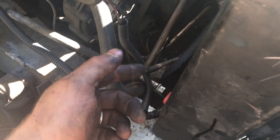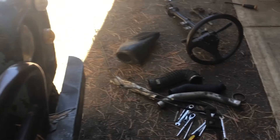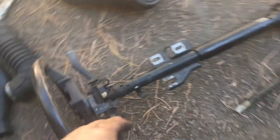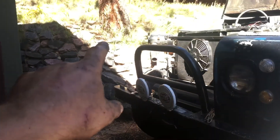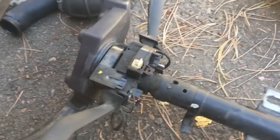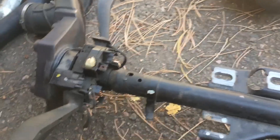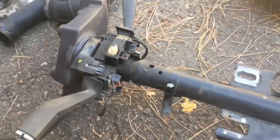The big difference between the Defender and Range Rover power steering box is that the P38 box mounts to the outside of the frame. I don't have room to put it on the inside. The rounded part of the head will sit very close to the radiator, but you can see the linkage and column will come right up in there. I'll be using this column so I can mark the other one and sell it. I'll drive temporarily with this steering wheel, then get fabrication done to fit an original Series 3 or Defender wheel to keep the look as classic as possible.